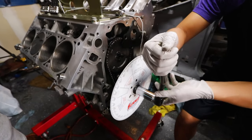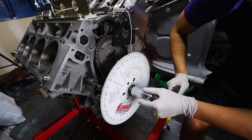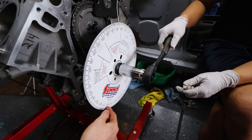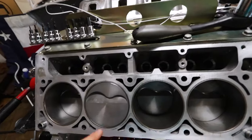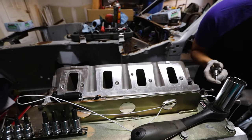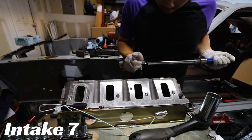This is the part we screwed up last time because we couldn't turn the crank. Now we've got to rotate this 360 degrees - one full revolution. Once we get this back up to zero - that's zero - and see, this is 180. We managed to go a full revolution and now this cylinder is at top dead center. So we should be good to torque down the rest of the rockers. This is probably what screwed up on the Corvette the first time - we weren't able to get that exact 360 degree revolution and we torqued it down anyway. It's very easy to go over 360 if you're not paying attention; we almost did it just now even with a degree wheel on it.